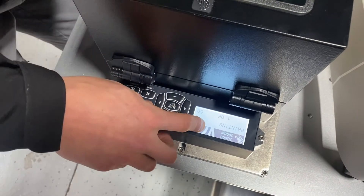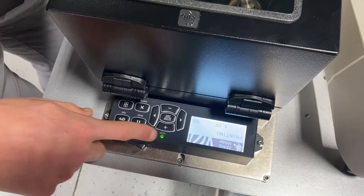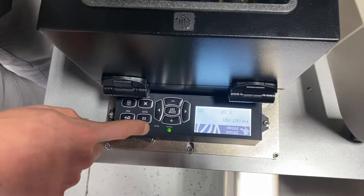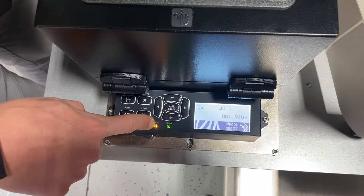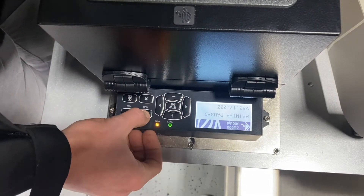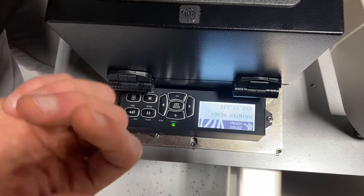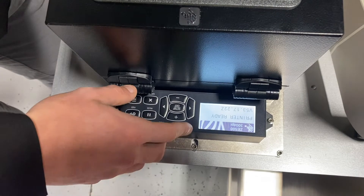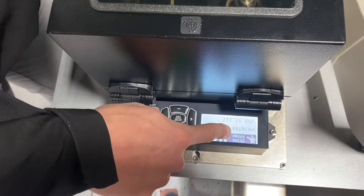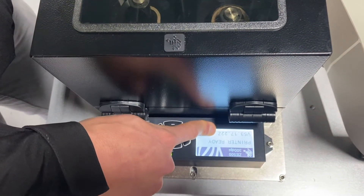One thing I had mentioned before is you can always clear out whatever's in the printer's memory pretty easily. So if I don't want to print these labels and I want to send a different design down to it, all I have to do is hit the pause button. I see the pause light lit up and I hit the cancel button. This then takes me to a printer pause — unpause it, now I'm in a ready state. Right here tells me the model number and the dots per inch of my printhead. Right now I'm using a 300 DPI printhead. This is my firmware version as well.